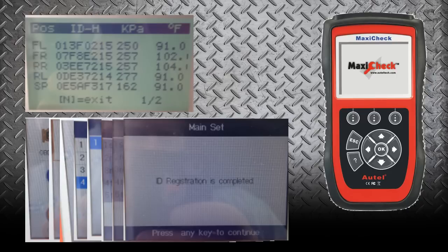Remember that not all vehicles need to be programmed directly to the PCM. Some vehicles, you will cycle the key and push on the brake pedal, and then as you move around the vehicle to scan the sensors, the horn will honk — and that's how it learns. Vehicles like Toyota, Nissan, Honda, and Hyundai require that the ID be programmed to the PCM.